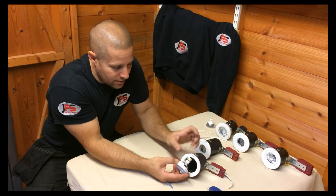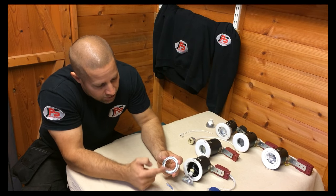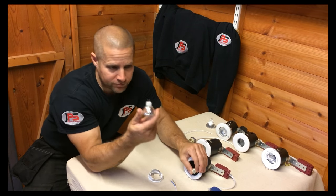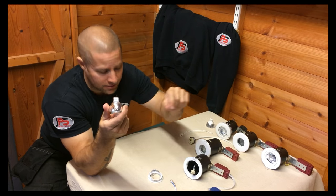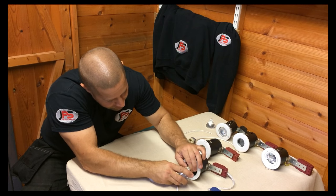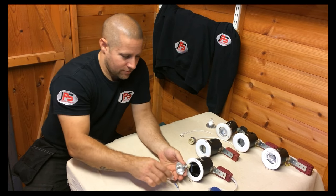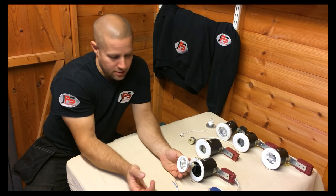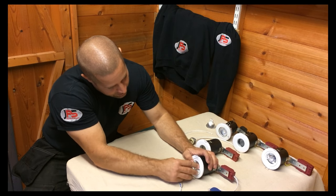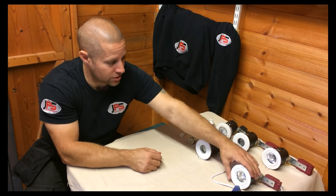You'll notice that the lamp is held in place by a clasp that fits around the lamp itself. Now the low voltage lamps — light bulbs — you see the two pins there; all they do is they line up with that one there, give them a push. New fittings can be a bit tight. And then put the clasp around it, line up those two bits there and just give them a twist clockwise. That's it — that's the bulb change on that one.